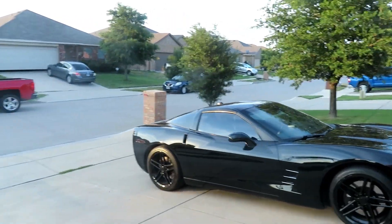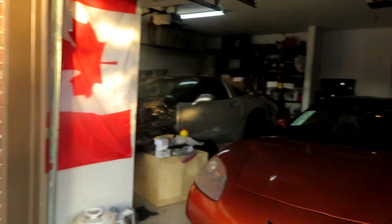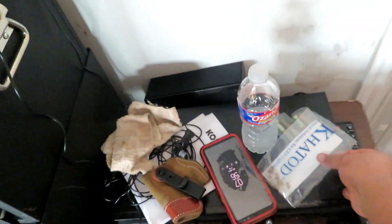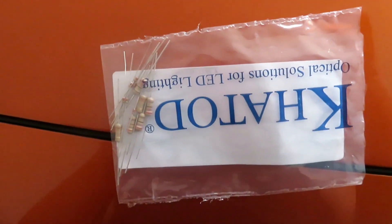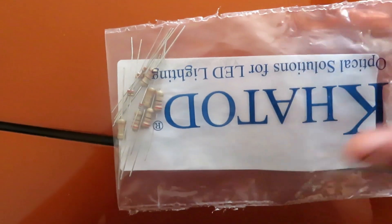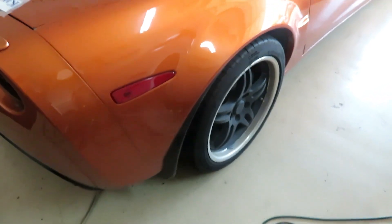The last option — I found a post on the Corvette forum where a guy modified some resistors so it sends a false signal that the passenger tank is always empty. I got some resistors from work; if I had to buy them myself it would cost about $3. The fuel sender unit operates between the upper 240s to low 250s in ohms.